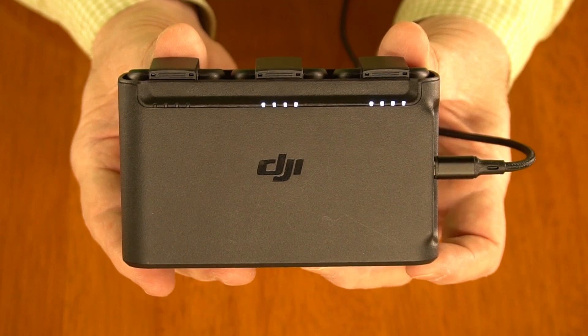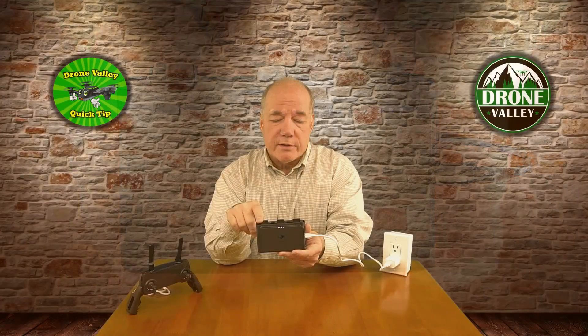To do that you have to have the right charger and the right cable, and luckily DJI is giving you all of those included in the kit. So when you plug the charger in the wall outlet, plug your cable into the charger, then plug it into the side of the unit. This is using the Qualcomm quick charge standard, so if you're buying another wall charger, make sure you get one that's QC3 or QC2 compatible and you'll be able to quick charge this unit.